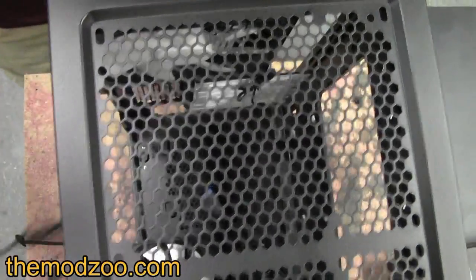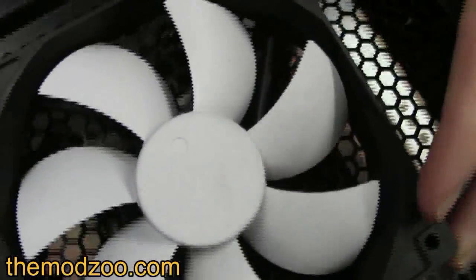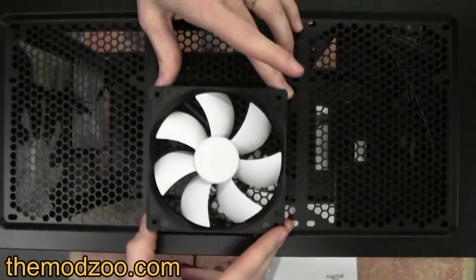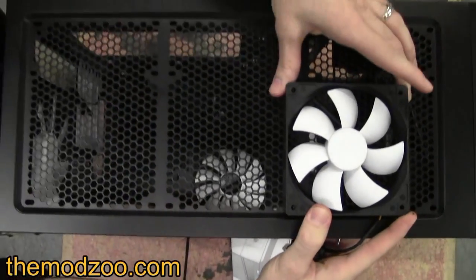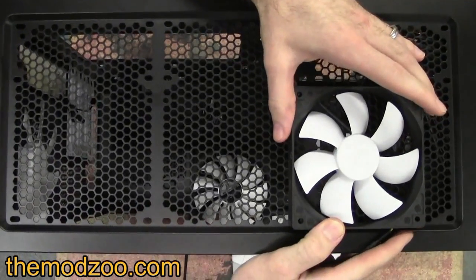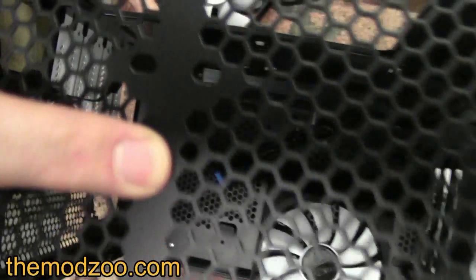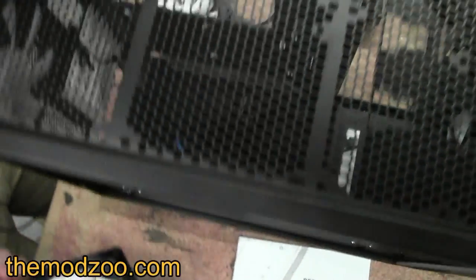Alright, so if we take a look at some of our dummy stand-in fans, some of your possible configurations are 120 millimeter here. There's more mounting holes for them here. And then there's a 3rd set over here. And you may have caught, I did say mounting holes. They are holes, round and not oval, so those are not slot mounted. So if you don't have the proper 120 millimeter radiator sizing, what is it, 15.5 millimeter, 15 millimeter, you're going to have issues there.